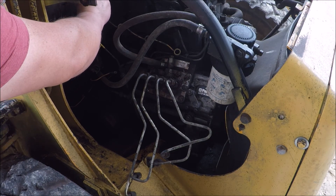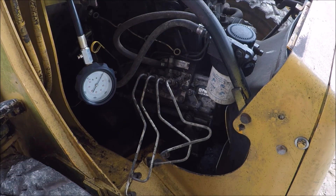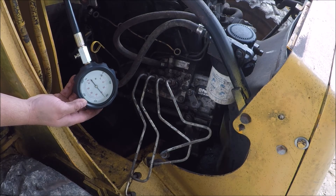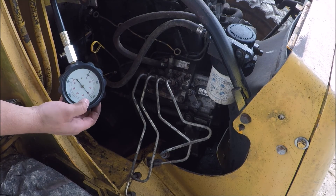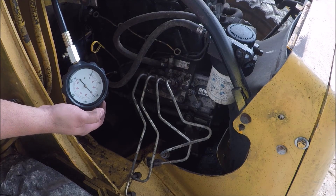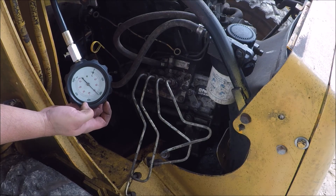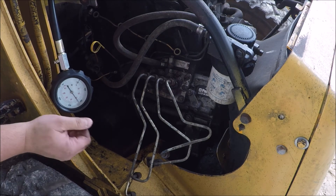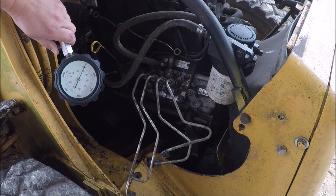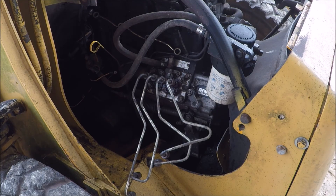This time I've got to go this way because it's going to be hard to get that on. There it goes — the pressure has been released. Let's see if this one builds up okay. As you can see, if I keep running it, it'll build up a little bit more. I'm just stopping the engine when I see that needle really isn't gaining much more. This one went a little bit over the rest because I ran it a little bit longer, but it's pretty much the same as the rest. Looks like we're doing good — the cylinders are fine, there's good compression, and I shouldn't have to worry about any loss of compression.